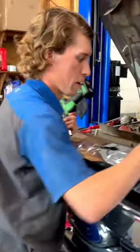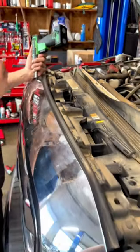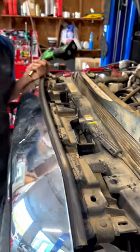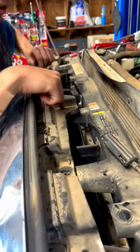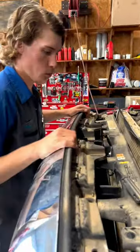First thing we're going to start by doing — we have four 10-millimeter bolts up top. Something I would highly recommend is making a mark here where this thing goes, because it does matter where you put it back so that the hood can seal. We're going to pop these four 10s out. You have a lot of room where these bolts go, so you want to make a mark of where it was.